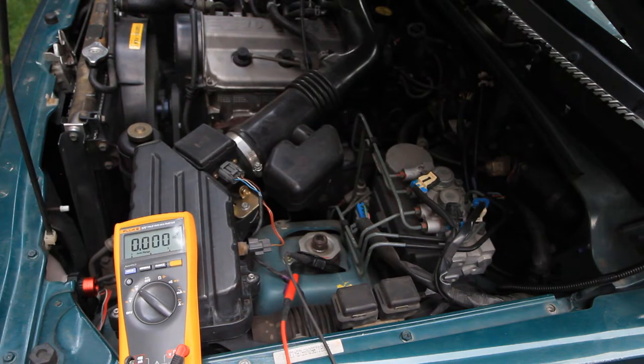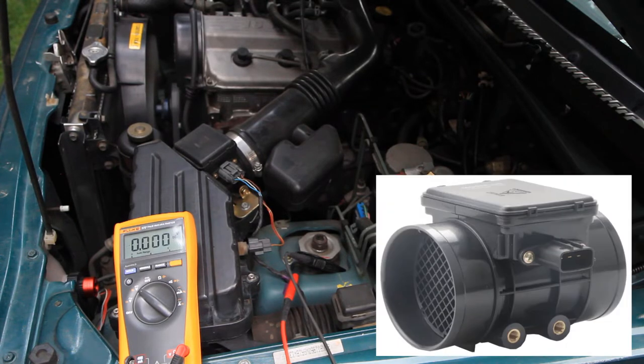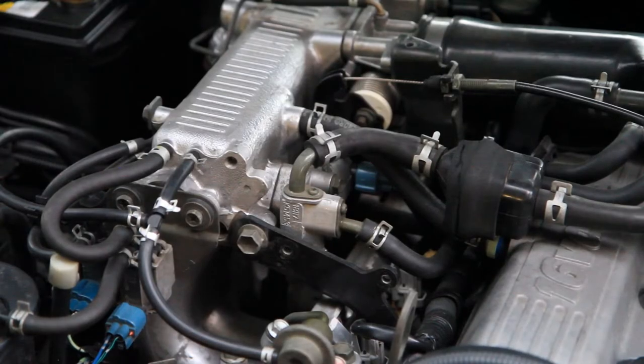When I did my first test, I got zero volts out of the MAF, so that confirmed it was bad. I initially fixed this with a new cheap Chinese mass airflow sensor. I did end up changing out that aftermarket one because I was having so many other issues with the car and wasn't confident it was providing an accurate airflow reading. Even though it was working, I wasn't sure it was accurate, so I swapped in an OEM one I picked up. After changing the MAF, I reset the ECU.